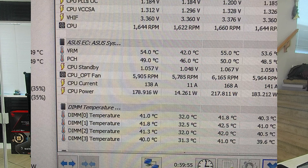Note to self: put a fan on the back of the motherboard in every build from now on. The final result combines both — the 120mm fan on the back of the motherboard and the VRM fan on top of the RAM sticks — and it dropped to 41.8 degrees on the RAM. That's a total of 14 degrees drop on the RAM sticks. Best bang for the buck would be the 120mm fan on the back; the VRM fan just drops it by an extra five degrees for good measure.